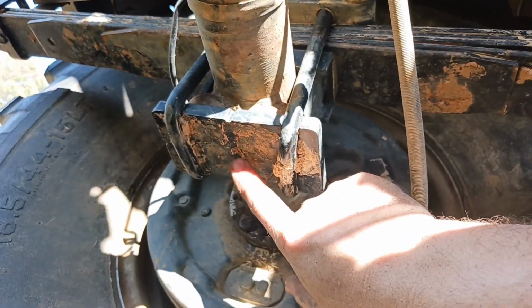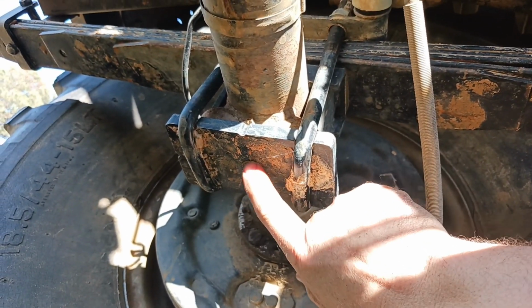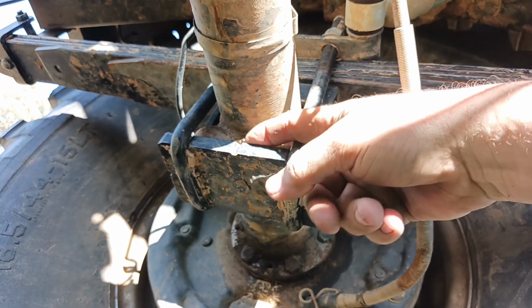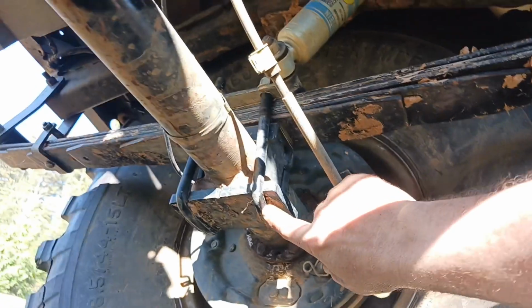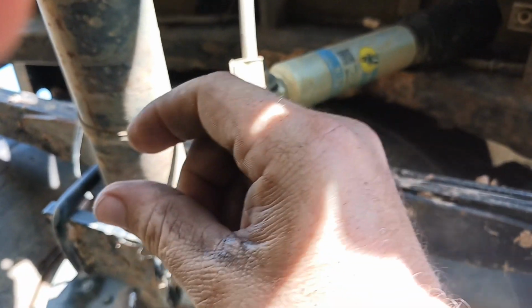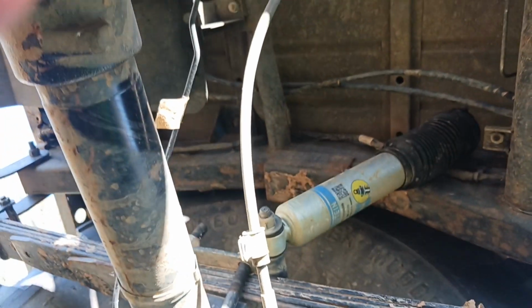And the tie bolts. Every one of the tie bolts, instead of being welded here on the non-important flat side, they put the weld up here, and it got in the way of the tie bolt going in the hole of the rear end, up in the saddle. So what I did, you can't see it on that one because I repainted it, but I welded it and ground it back down smooth. You can see that one still, kind of. What was happening was they weren't coming together. It was a big old gap there, so I had to grind the weld down and redo that.